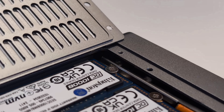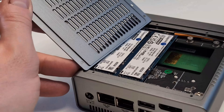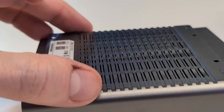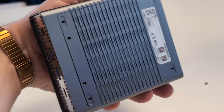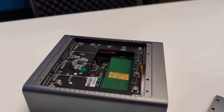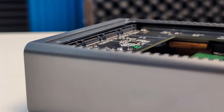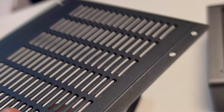Space is incredibly thin inside this device. The drives live underneath the panel, and with all four drives installed, the space for thermal pads is very small. You want the drives connected via thermal pads to the dissipating panel — that's correct — but you don't want thermal pads blocking the vents, because the afforded space really is quite small. When we had all four covered in thermal pads, we had to use especially thin ones. Standard thermal pads I had completely covered and blocked the bottom panel. There is a distinction between making contact with the metal chassis and over-pasting and ruining airflow.